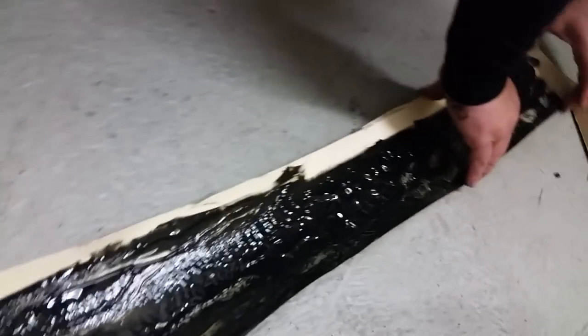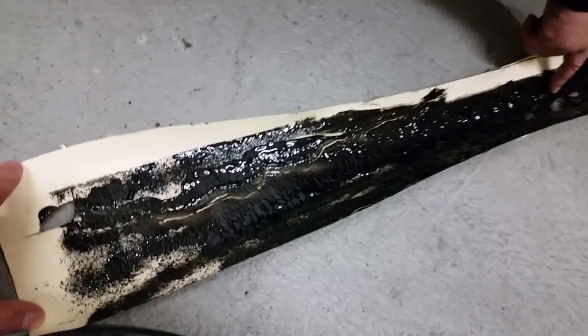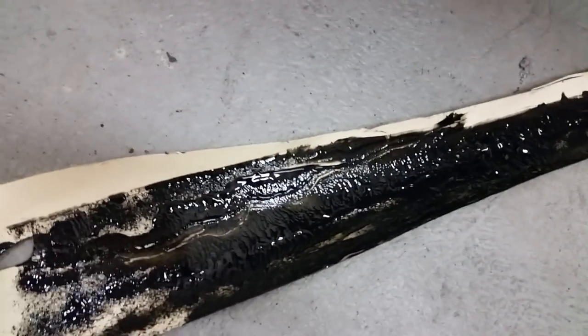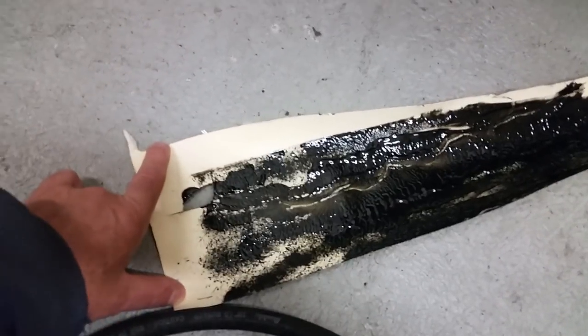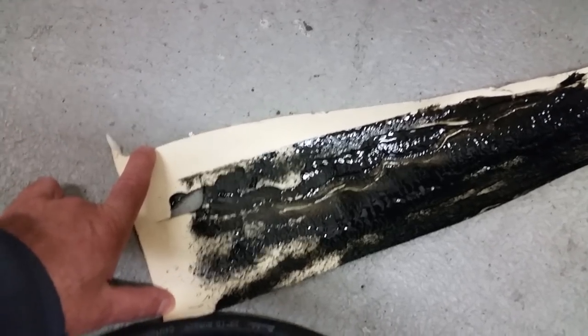That part that's not covered was the overlay section — that's where he had it taped. You can see he's got pretty much 90% plus coverage on this tubular frame. We've been working a lot with our extension wands and specifically our fittings, the ends of these extension wands. We made some modifications recently to the 360-degree tip — I think it's a huge improvement. We weren't real happy previous to this. For the last month or so, we've been using these modified tips and it seems to be doing extremely well. I'm very happy with this. Those little white spots you see — the Woolwax will migrate and creep out and they'll get coverage.